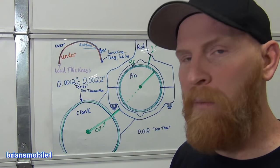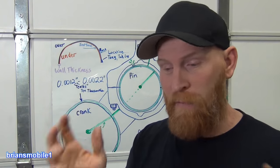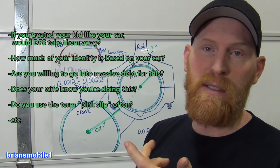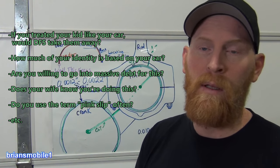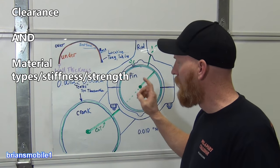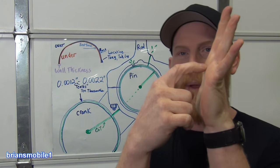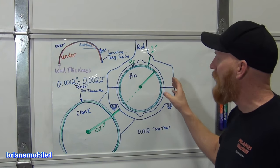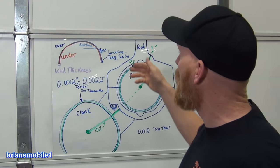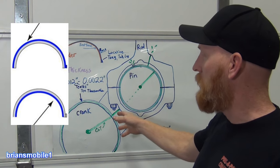Whenever you're doing bearings, if you can have your machine shop select your bearings and give them to you, that's ideal. The first thing they're going to do is ask you a bunch of questions: Is this a road car? Is this a track car? What kind of horsepower are you doing? The reason why is that's going to affect what the clearance is going to be. All the adjustment we do to the crank is to get a nice smooth surface that passes our fingernail test. Beyond that, all that clearance stuff is made up by what bearings you select — the bearings will be thicker or thinner either on the steel back or on the aluminum alloy surface depending on what your clearance is going to be.